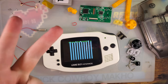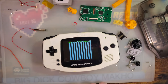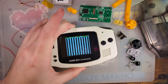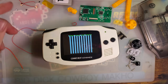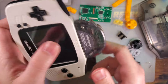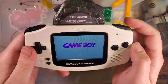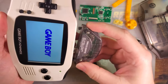You got either pin 1 or pin 3. Pay attention to what your seller tells you. If you get your kit through Retro Game Repair Shop, which both of these are actually through Retro Game Repair Shop, chances are pretty good you're going to be using the pin 3 wiring, not the pin 1, but double check anyway.